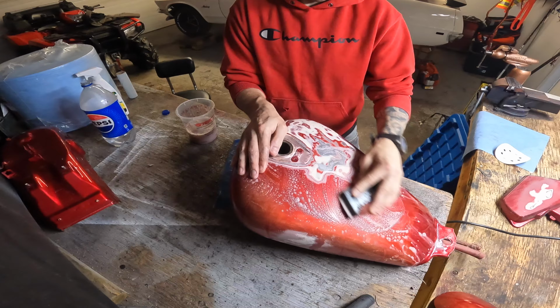Super nice. That kind of shows you the color it was, that there is really nice. My first time doing a paint job like that, so I primed it, then it was a silver metallic, and then you get candy red, which is basically transparent red, and then clear. Pretty cool.